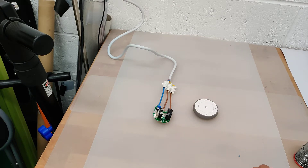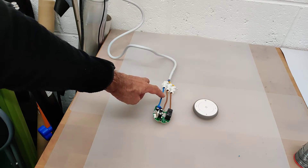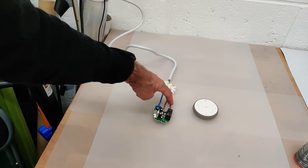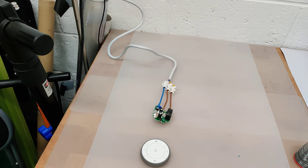Normally this is a 20-pound unit which IKEA sells in the UK. It's got a mains plug which would plug into your standard wall socket, and on the top it's got a female socket that you'd plug any old appliance into. The device can switch up to, I believe, three kilowatts. What you've got is a neutral, a live, and a switch live — this is the input power to the device — and then this wire is going to be switched on or off depending on whether you've pressed the button or whether you are using your IKEA smart app.